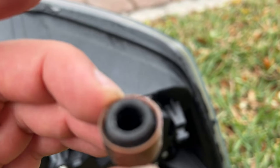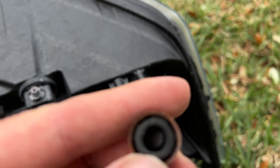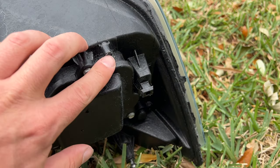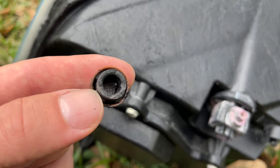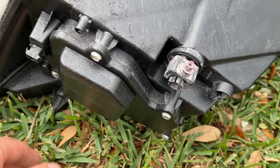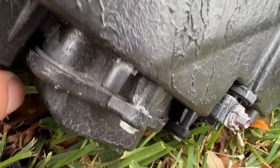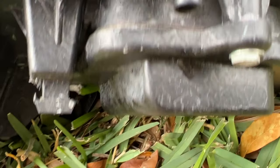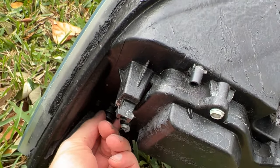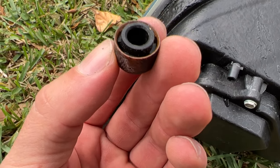These caps have a little filter in them — a small foam element that allows the headlight to breathe. You're supposed to let them hang on just barely so the headlights can breathe. I'm going to have to pick the silicone out of these now. Actually, you can see there's water inside of this cap — it was trying to escape but it was pressed in too far. There's water hanging out from the inside of this cap; it just dripped out. The condensation is trying to escape but he's got them siliconed off, effectively making the problem worse.